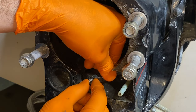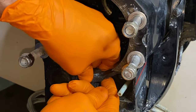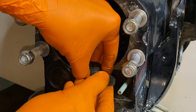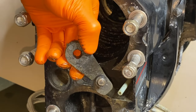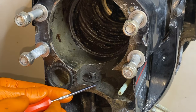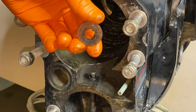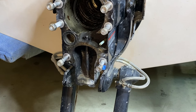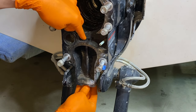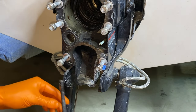Loosen it to a point where you can pull the threaded pin out, then carefully lift up on the latch and pull it right out. There's the bottom side. Next, grab a pick tool and carefully pull the washer out. Then shift the camera back to give a full view of the shift cable shaft as it goes down and out of the bottom bushing — there is the oil seal.